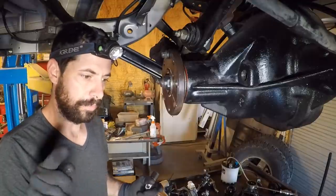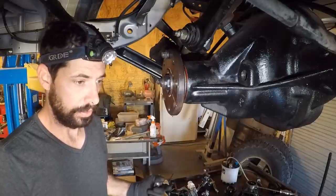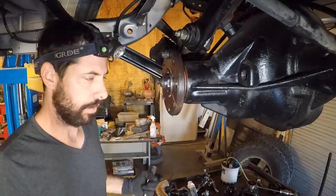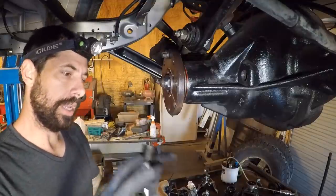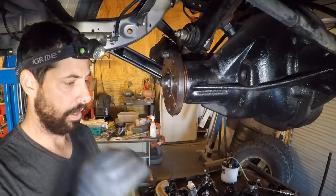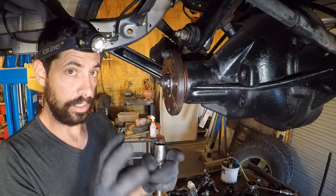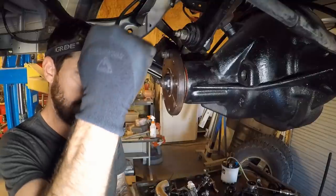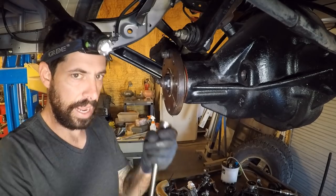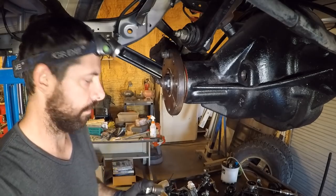There's a video where I do new gears in a Ford 9-inch, and I made that video because there wasn't any good 9-inch videos as far as I could tell. There's a couple good 8.8 gear swap videos, so that's why I'm not doing it in depth. But on the 9-inches, what I do is I actually will preload it with a press. Because the pinion carrier on the 9-inch comes out on its own, you take the pinion carrier assembly, put it in the press, and you can use the press to kind of break that crush washer to start the process, and then you can manually adjust it. In this case, I'm going to have to do the whole thing by hand. It's a little bit difficult, but we'll get it done.